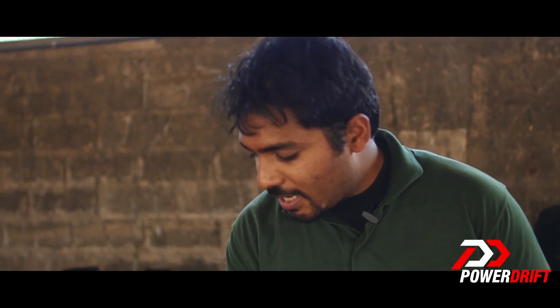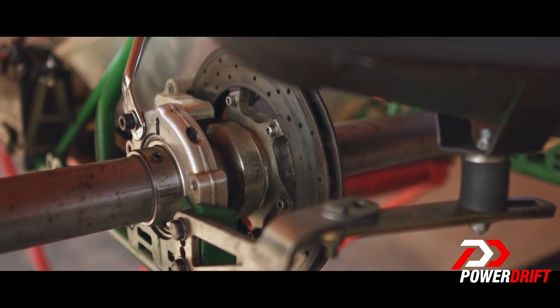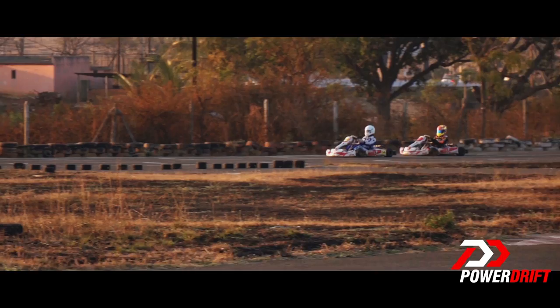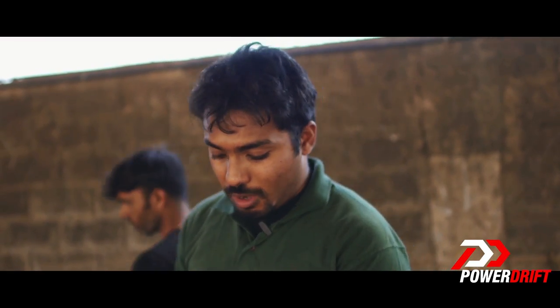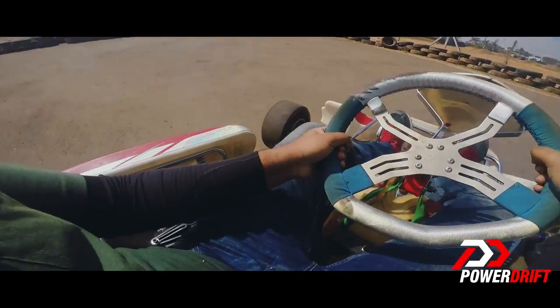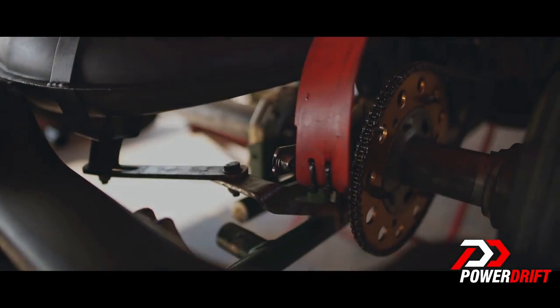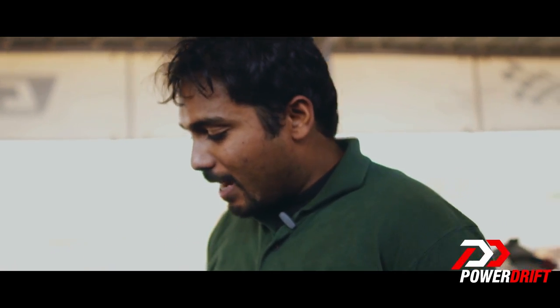But as you can see, the brake is mounted to the axle. It's tricky to get the braking right because there's no ABS on this, and the brakes lock up like that. And the moment they lock up, you're effectively locking up the axle, which means that your back is going to wash out. This is a 28 bhp 125cc motor. Again, it's mounted to the axle. So don't even think about braking and accelerating at the same time, because again, you're going to wash out.